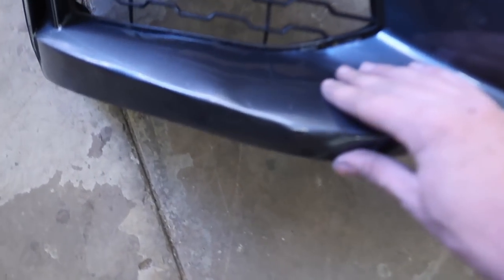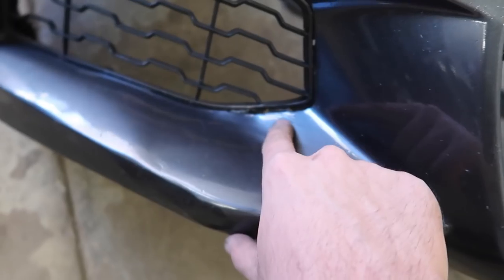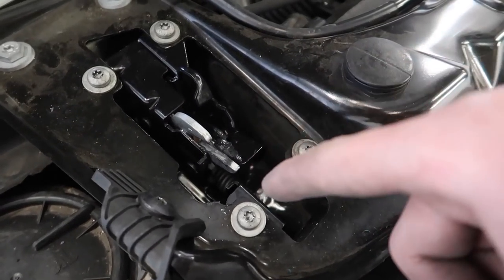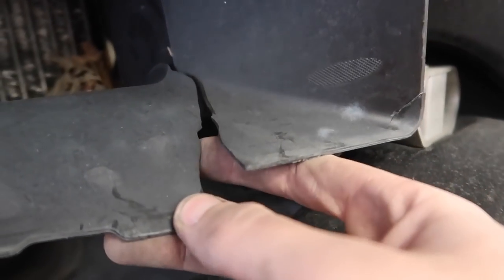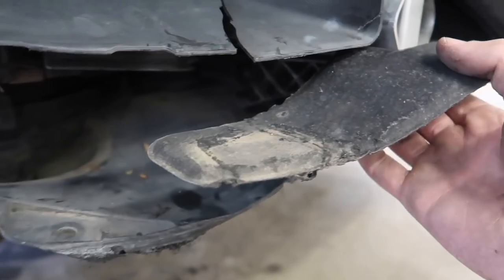When I got this car, I noticed that this right here is a little bit morphed. It looks like it's been clearly repainted. Also right here, that's pretty clear, and up here it's like wavy. This is pushed in. Looking at the other side to see if there are any damages — this hood latch wasn't working, this bolt is rusted out, which is kind of weird. The hood doesn't look like it's been repainted and it doesn't look dented at all. Looking at the headlight, the mounting all looks perfect. There's a slight crack here and this is slightly damaged, but other than those two, everything else looks good. So that leads me to think the damage in the front was very minor and I'm not too worried about it.